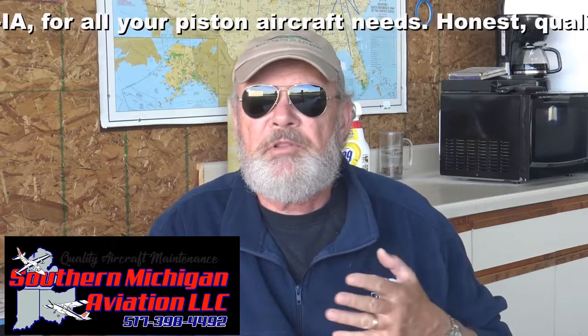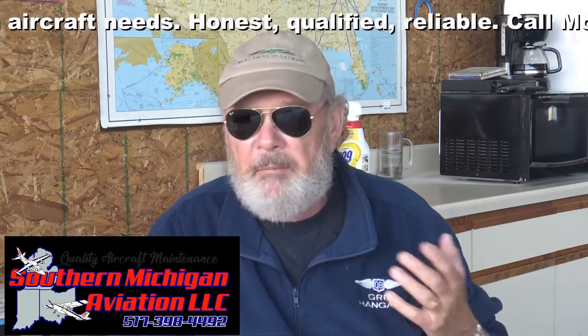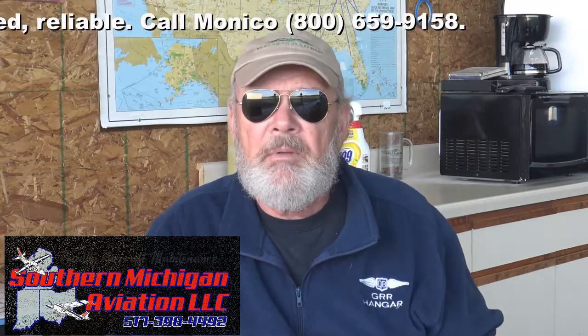The tailwheel springs work good. Temperatures and pressures are all good. Senders are all good — we replaced all of those because we had problems. That's what you get with a resurrection. Cowling's working good — all cleaned up now. Prop is working good; it was not torqued, causing vibrations and problems. Thanks to Lonnie Prince for your input. For now, it's Captain T from the Skunk Works. I hope you have a grand Friday. So long.